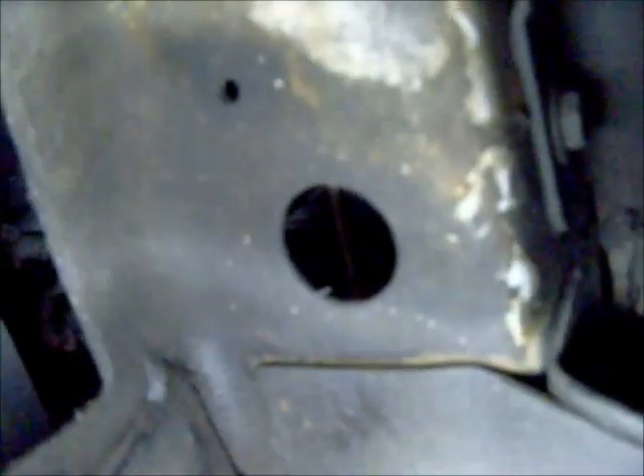I don't know how well this will focus, but this is the relay. It's up underneath on the frame, as you can see here, next to the radiator. There's the drain plug right there, and then you come over about four inches, and there is the little rascal that's potentially the problem for keeping the cooling fans from running.